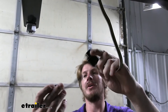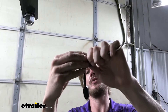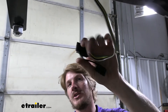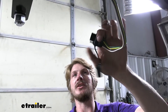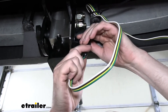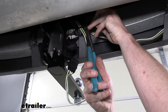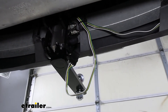We can now install the dust cap. The exposed pin there is going to be on the same side as the little hoop there, so we're just going to slide the hoop over the end — and this will just go over to protect it from corrosion. You will get some dielectric grease included with it. We're not going to be putting it on here today for demonstration purposes, but you'll want to squirt that up inside of here to help protect it against rust and corrosion. And then when you're not using your wiring, you can simply wrap it around and secure it to the safety chain loop on our hitch. At that point it's just cleaning up any of our wiring — you can use some more of the zip ties included with the kit to further secure the wiring and snip off any excess.